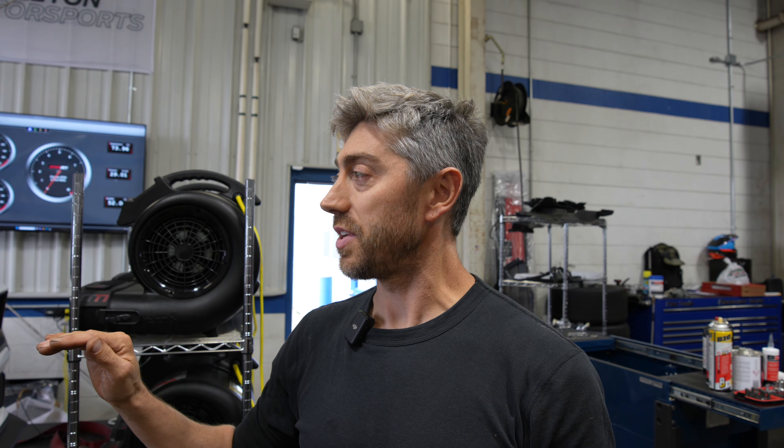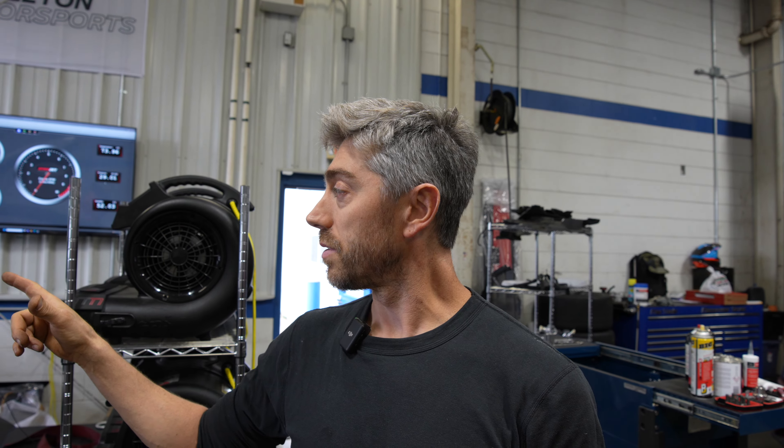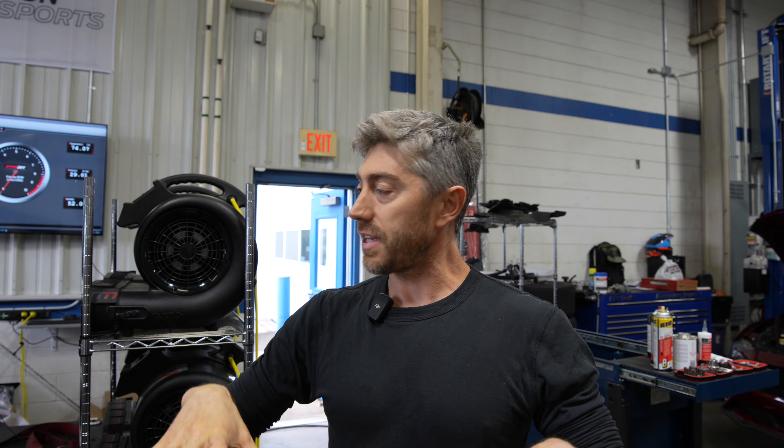What's going on guys - we've got Chuck's 2024 Dark Horse up on the dyno again. You've seen this car before; we did a baseline on it last week. Today we're back because we've been seeing buzz on the internet about taking the carbon filters - like a carbon trap - out of the intake tube. These S650s have twin intakes, and the air boxes have a secondary kind of air filter in them.